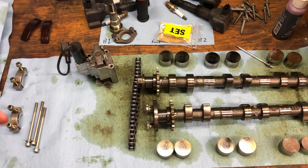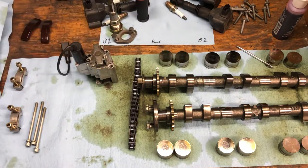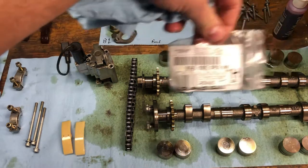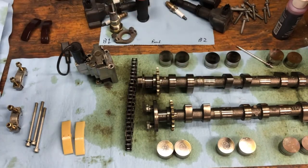Let's get our old VarioCam pads out of the way. Here is our new set. As you can see, we've got cams sitting here. They are ready — we're going to be putting those in time today, and then we'll move on to putting the engine in time, at least putting bank one in time. By the way, this is the part number for the pads, in case you are curious.